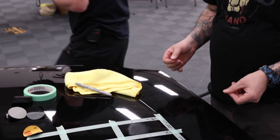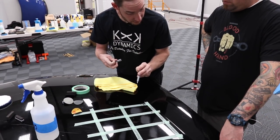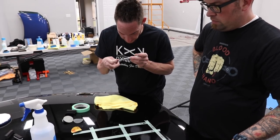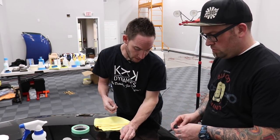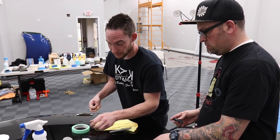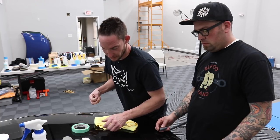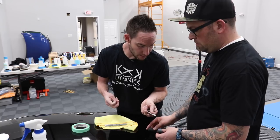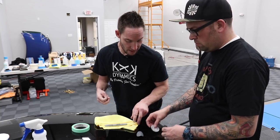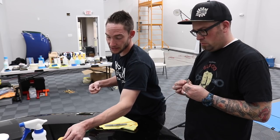Okay, so last number I got was a 112. So that was 2,000? Yeah, so we were able to do 2,000. 1,500 and 2,000. And we only removed 2 microns. So now with 3,000, we probably won't even be able to measure. So you're using that block, correct? Yeah. Probably not even be able to measure anything.